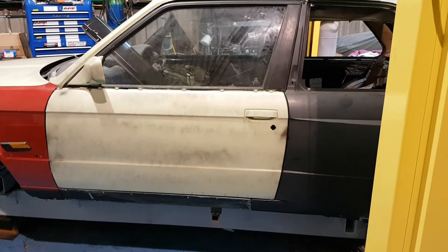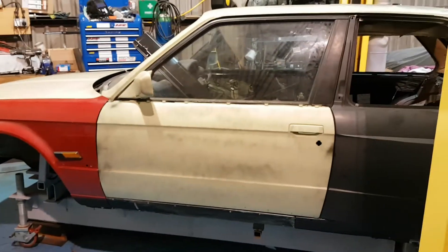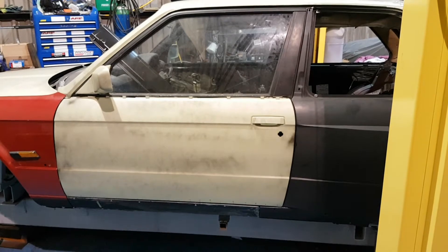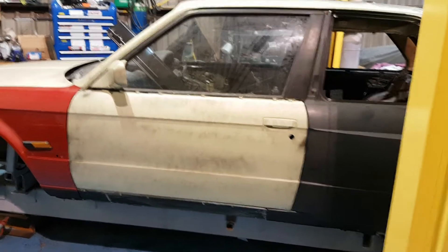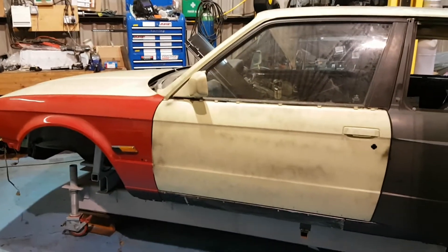What I'm going to do is drill multiple holes in the actual rear quarters and back panel now that I have everything lined up in the right position. I can drill dowel holes, and every time I put the panels back on I've got to line those holes up and the bodywork will be perfectly in line again.